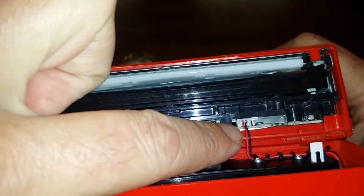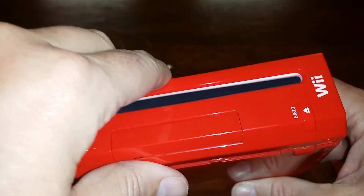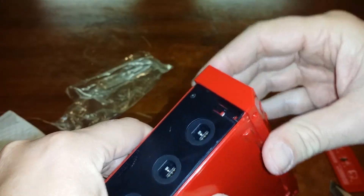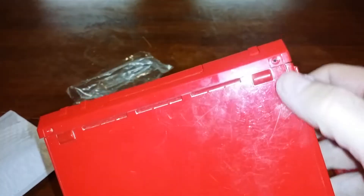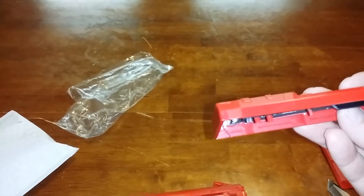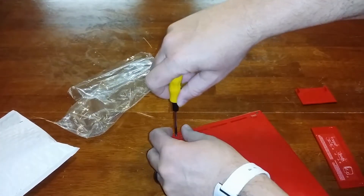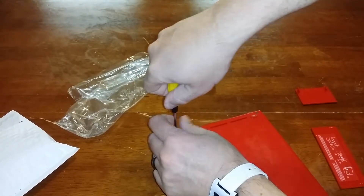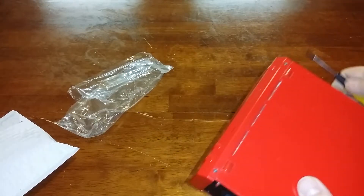I went ahead and connected the plug for the LEDs into the slot there, so it's ready to just fold it over and get it all lined up and ready to screw back in. The new faceplate does not come with the little stickers to cover the screw holes, so always make sure to use the ones that are already on your old faceplate — there's one here and one here. I'll just peel those off and put them on once I get the screws back on. Go ahead and screw in the last one down here. Just get it to where the stickers sit flush — you don't want to screw it in too much because it is plastic.